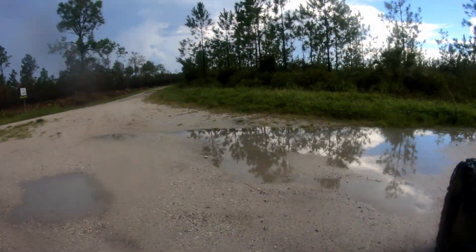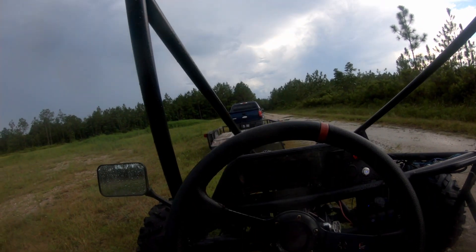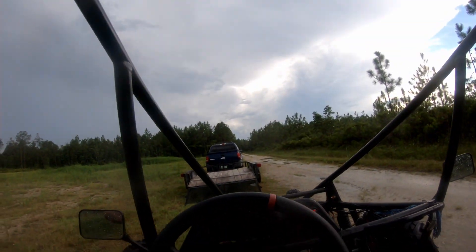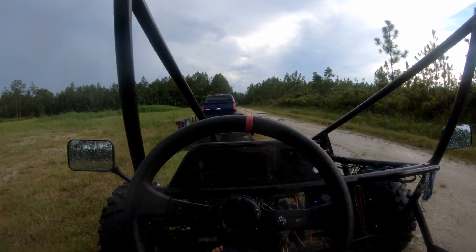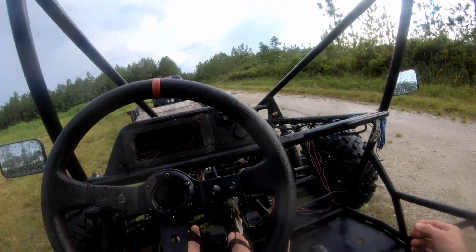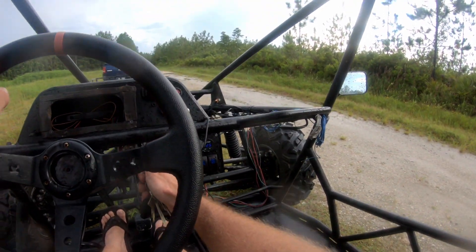I just checked the laptop and hooked everything up. My fueling appeared to be okay — it's definitely running rich. Even when I stab the throttle, it's still running rich. Without load it's like 11 to 12 AFR, so under load that's probably a real-life 13 to 13.5 AFR. Absolutely making pressure — we're making boost. Over 100 kPa means we are pressurizing that throttle body. My goal was about 150 kPa, which should translate to just under 7 psi. So let's try this one more time.